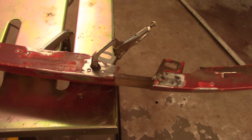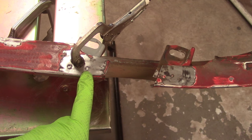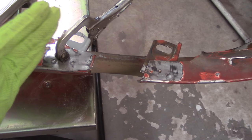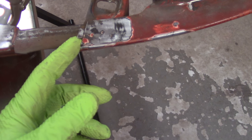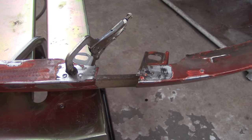Everything's painted and as aligned as I can figure to get it. This spot weld was not there, or at least not well done; this one was there, so I've lined that one back up. Essentially this piece aligns flush with this side — that's what gives it the angle when it's turned like this. You can't really compare side to side because one clip overhangs the valance itself while the other hangs inside it, so there's no real way to do a right-to-left comparison. You would think these wouldn't be aligned at all on the car since the frame is centered up.